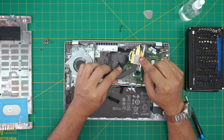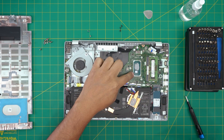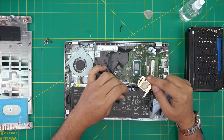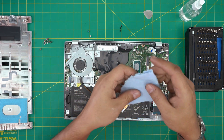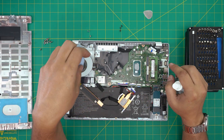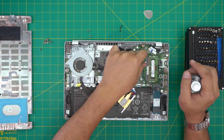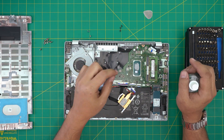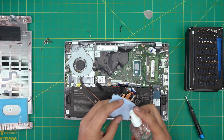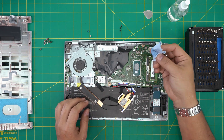There we have it. You can see this is a pretty new laptop — the thermal paste is still fresh, but we're going to clean it anyway. Notice the second die doesn't have any thermal paste and the heat sink cutout doesn't cover it either. That's because the second die is the PCH chip, which handles data transfer. A few years ago it was on a separate part of the motherboard, but now they integrate it beside the CPU to save money and improve response time. You don't need to put thermal paste on that die.